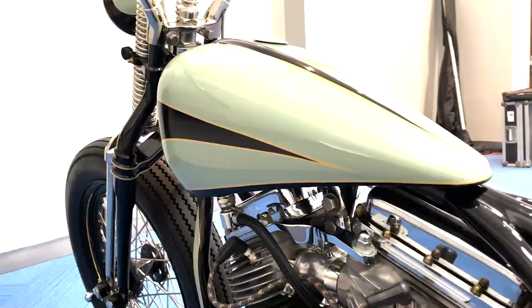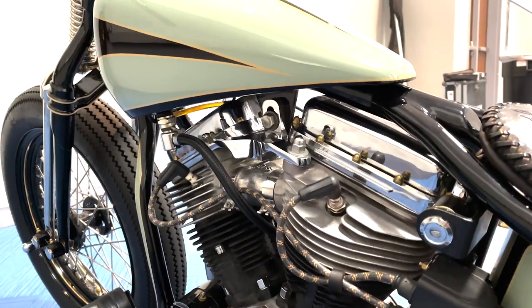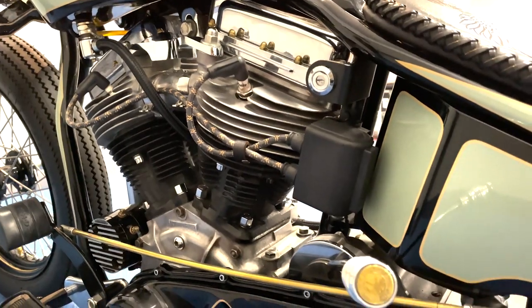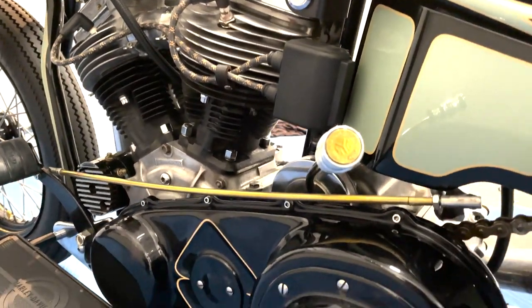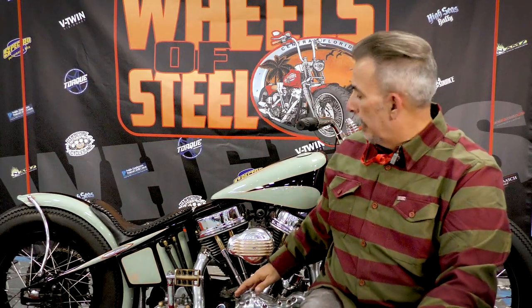This is what I came up with for him. The motor was supposed to be rebuilt, so he never was able to get it started. When he brought it to my house, I got it running, but it just continuously kept fouling plugs — it was oil fouled and needed a complete rebuild. So I did a complete rebuild on the motor and it's a nice, fresh rebuild. But it wasn't running at the time he brought it to me.